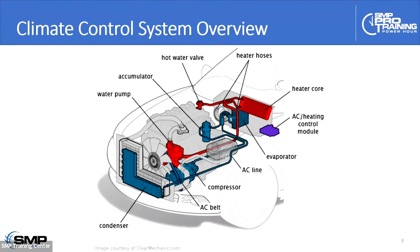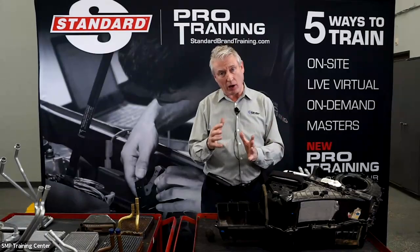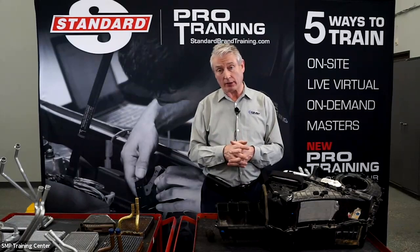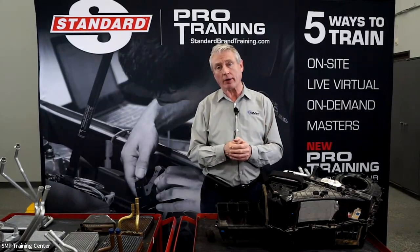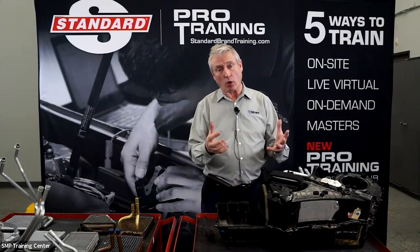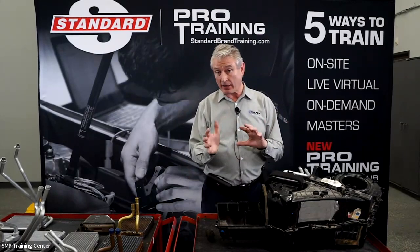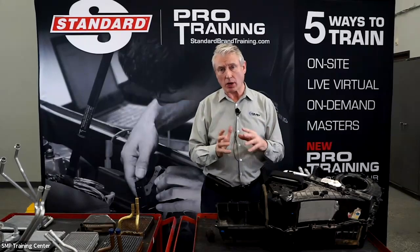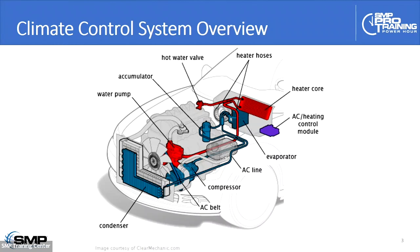The first thing I'd emphasize here is a climate control system overview. These days we call it the HVAC system — Heating Ventilation Air Conditioning — meaning it's the system that has to keep us cool on a hot summer day and warm in the wintertime. A problem in one system can often spill over or affect the other. For example, in the wintertime when you're defrosting the windshield, typically the compressor runs to chill the air and drop the moisture out before we blow the air through the heater core to re-warm it and blow it up onto the windshield. So a problem in the air conditioning system can certainly affect heater or defrost operation. These systems can be very integrated and interdependent.